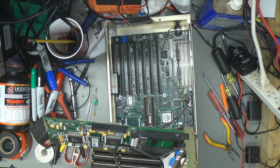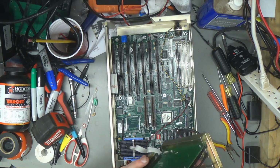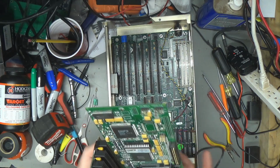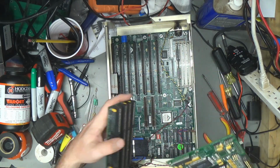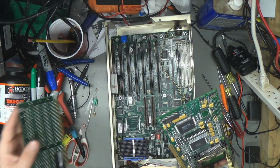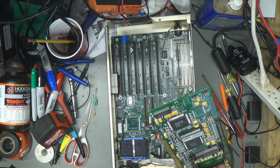Yeah, it's got an unpopulated DVI connector over here. That's very strange. This is a strangely modern-ish type of card to have in an old machine like this. And there's a little bit of electrical tape on the back to keep it from shorting on something. Very peculiar. And the back plane ought to just unplug here now. Here's the back plane. It was just plugged into this right-hand ISA slot, right like that. Very interesting. So I guess it tracks a VLB 486 motherboard would still have an AT style power connector on it. Wouldn't it? Yeah.